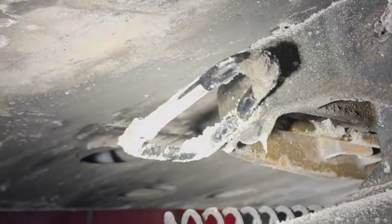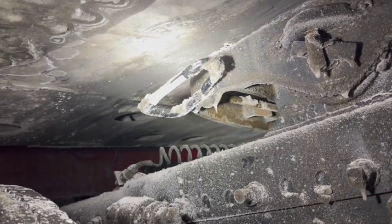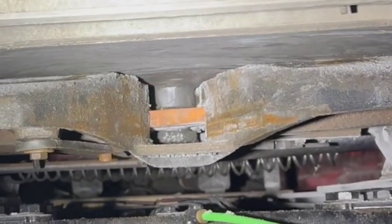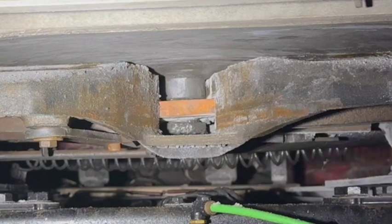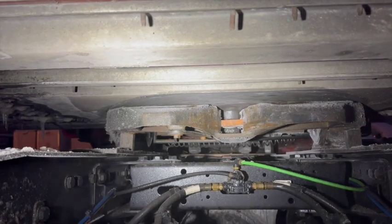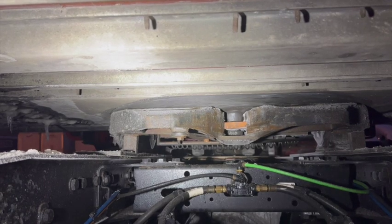I got it. What I needed to do was hammer on the release arm — it was basically ice keeping it from going in the rest of the way. Now it's nice and flush the way it should be. Can you guys see that the little tiny band of silver that was on the right side against the fifth wheel is now in there? I feel confident it's fully latched. I used the tire thumper to hammer on the release arm — I didn't even need a regular hammer. Now I'm going to thump my tires and take a look at the brakes.